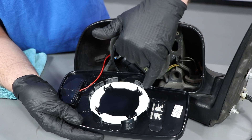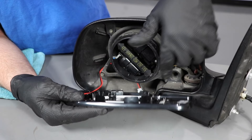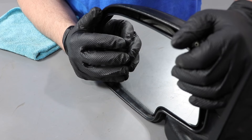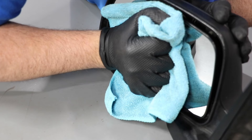With the new mirror, you're going to make sure this gasket is in there if your mirror comes with one. Make sure none of the old gasket is on this mounting bracket right here. You want to line this up right to make sure that goes on securely. Make sure those clips get lined up in there. Make sure the wires are out of the way if your mirror has wires. You're going to take a rag and push in the center of the glass, and you're going to make sure it clips in.